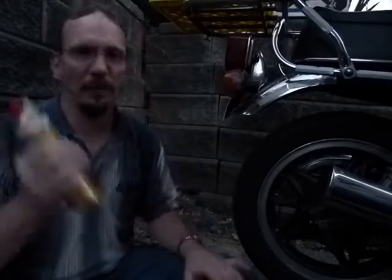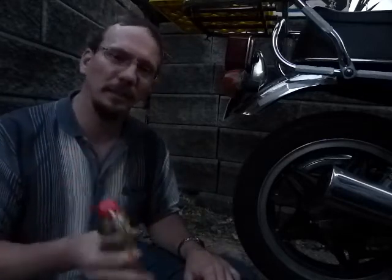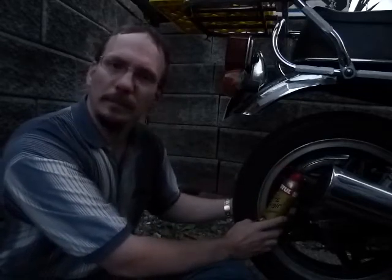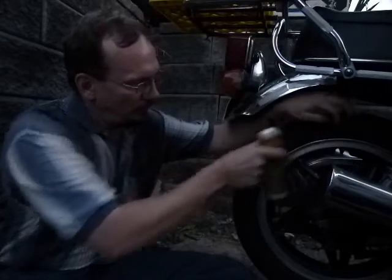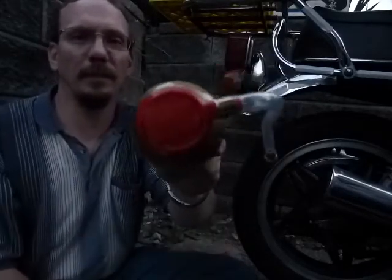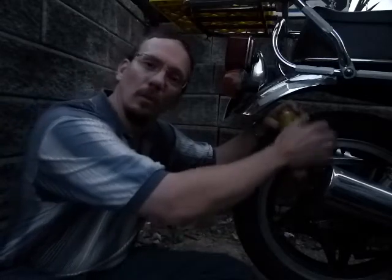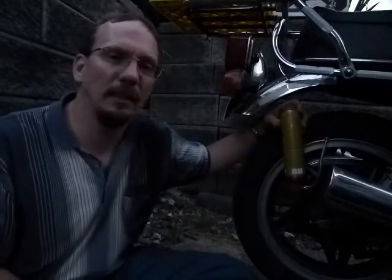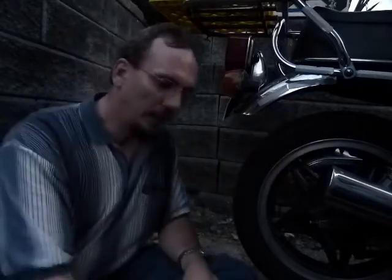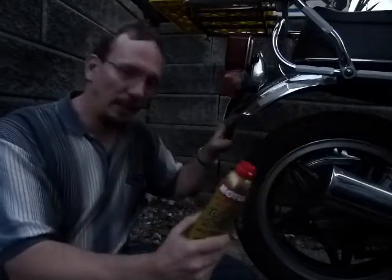You don't want to watch me shake it, so we'll skip that, but you have to shake it up for several minutes. When you're done, connect the hose to the valve stem. Rotate the valve stem up until it's vertical and upside down, with the can connected to it. Then just press the big red button at the end of the can and wait until all the foam comes out and transfers to the inside of the tire through the hose. You can see the foam bubbling through the hose. When the pressure equalizes between the can and the tire and there is no more foam transfer, disconnect the hose from the tire.